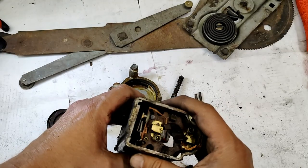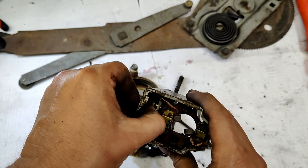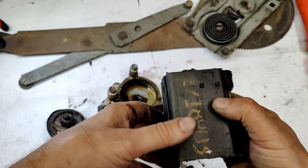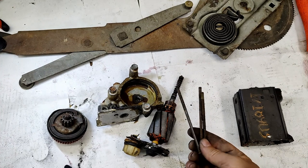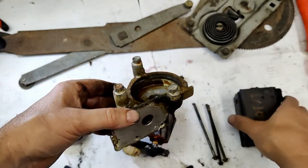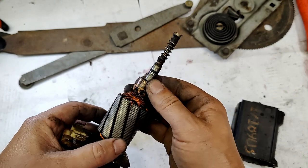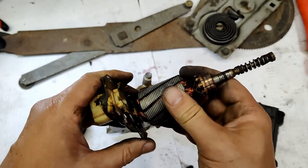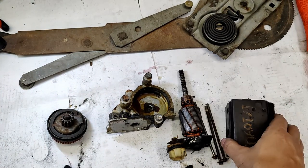I'm not sure how rebuild services go about disassembling these given how I had to cut the plug. There's also a contact point in there that might be a thermal limiter — if it gets too hot it breaks the contact. The part number is 1718903. The housing comes apart with those three long bolts to reveal the brushes. You can see this is pretty dirty, probably had bad contact, and there's corrosion on the armature — so I'm chalking this one up as toast.